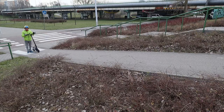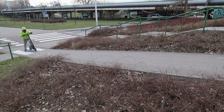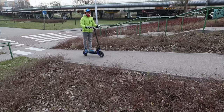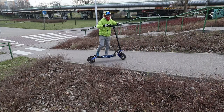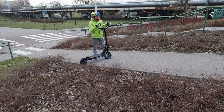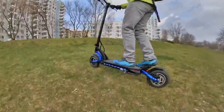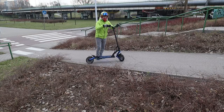We also need to test the hill climbing abilities. This scooter has 1350 watts, but the climbing ability might not be so insane. This is a 10 degree hill — let me show you how it handles it at full power. It still does accelerate, but more than 10 degrees will be quite difficult especially if you are a heavier rider. For small hills you can tackle them with ease, but if you live in a very hilly area I would suggest getting a more powerful scooter.